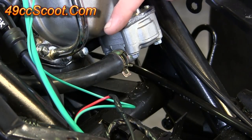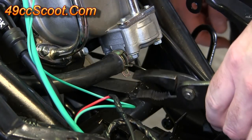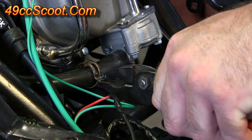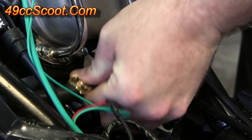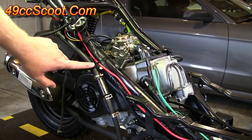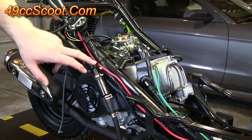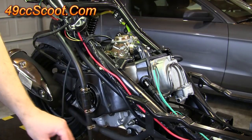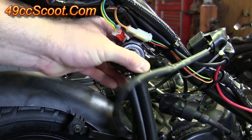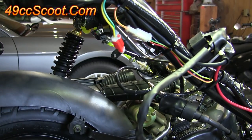Move up to the valve cover area and you'll see this large hose — it's got a clamp on the end of it. Take a pair of pliers, squeeze that clamp, and then pull it back out of the way. Once that's out of the way, you should be able to maneuver the hose off. Next, find any wire ties or anything securing these hoses from the canister to the frame or to the scooter anywhere and cut those off. Then the canister should just slide back off its mount on the frame and you can untangle it from any wires.